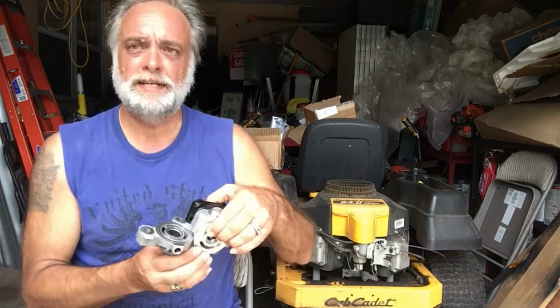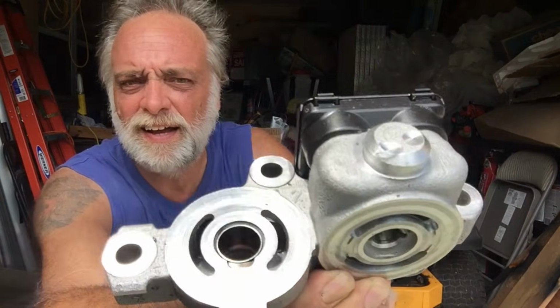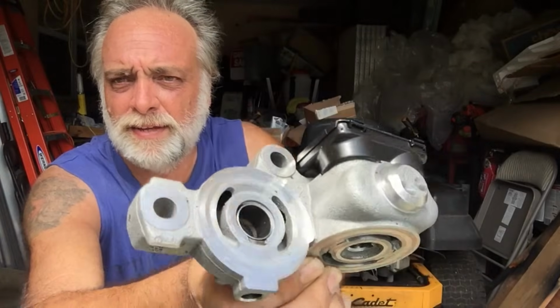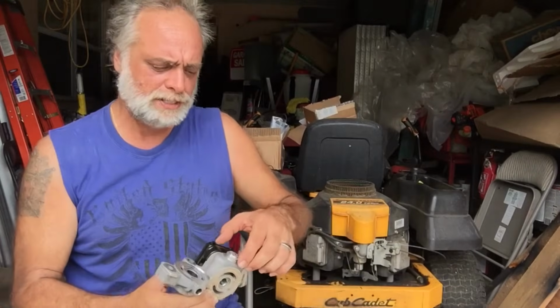So I'm assuming you're checking out this video because you were probably having similar issues as I was with your lawnmower, which seems like for the first 30, maybe 45 minutes that it's going okay. And then either slowly or rapidly you notice a decline in power on one side. There's a pretty common problem as to what causes that, and that is this, what we call the center section right here. I don't know if you can see that in this area here. Basically this whole piece is scratched up. If you can't see it, trust me, it's pretty well scratched and scored.